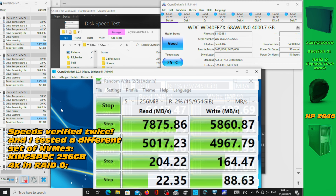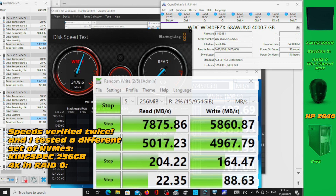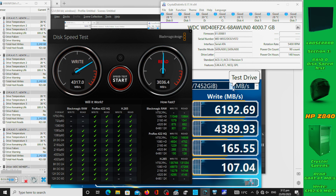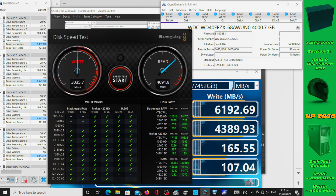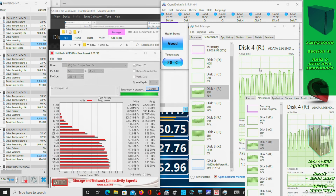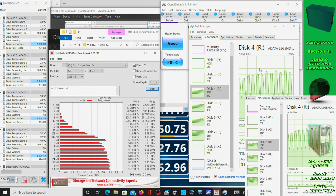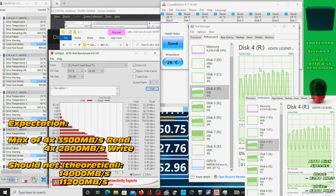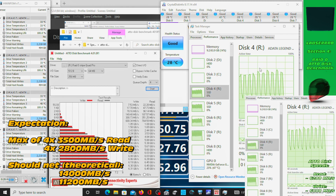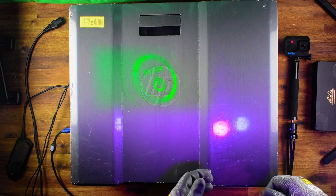High-risk storage — if the drive fails everything is gone. But here's the CrystalDiskMark data: pretty solid speeds at around 6,000 MB/s, though lower than I'd have wanted. Still a massive improvement over a single NVMe which is around 3,500 read and around 2,900 write. The Disk Speed Test is also running well, getting around 4,000 MB/s read and write transferring large files — great for video editing. ATTO Disk Benchmark nets very similar speeds, around 6.5 GB/s for read and write, but still slower than expected.